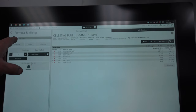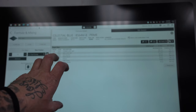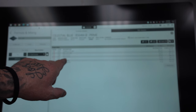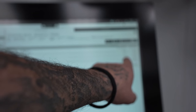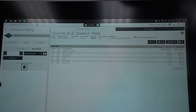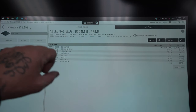So this here is our color — we're going to be starting out with the prime. This one is going to be about 15 ounces. When I look at this color, I want to be looking at the colors I know are really going to change it, which is going to be this violet — called T443 in the PPG line. So right off the bat, when I mix this color, I'm going to leave some of that out as well as the deep black. For about 15 ounces, I'm going to go with about half of the violet to start — leaving out about 15 grams — and on the black, I'll leave out about five grams.